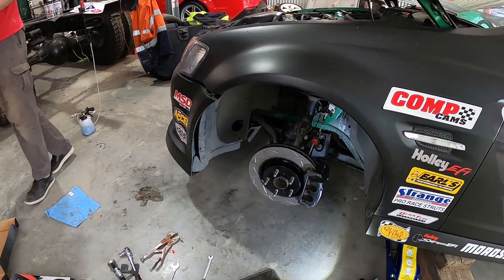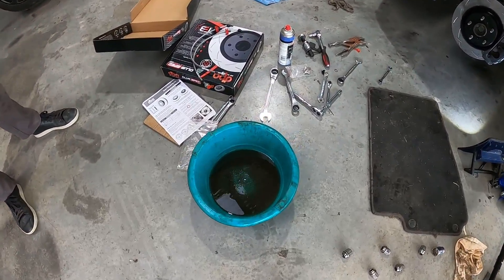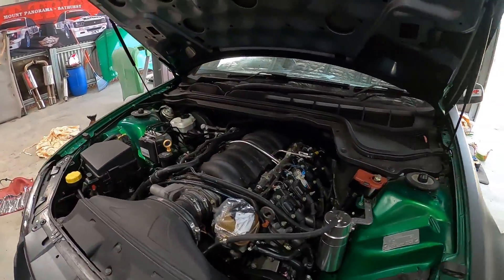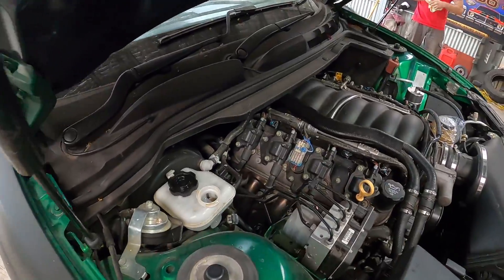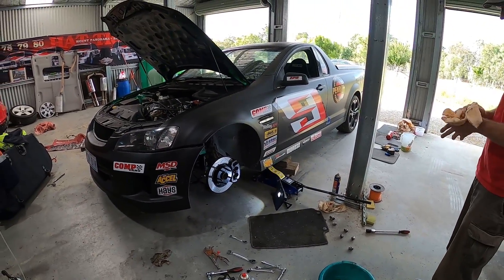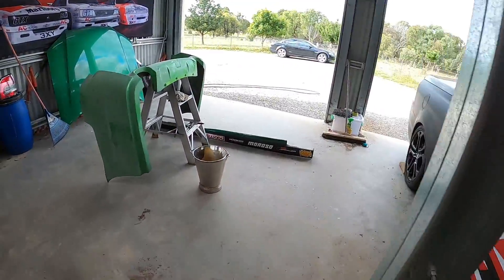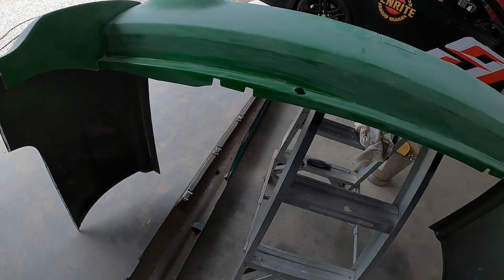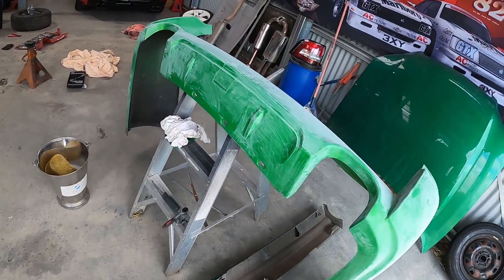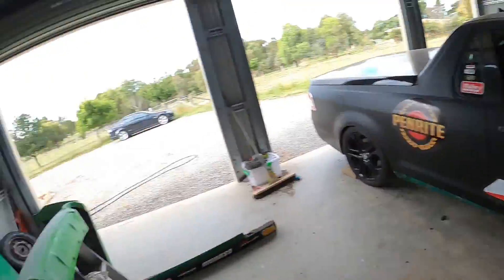We've just bled the brakes with our little two-man trick - nice and greasy and horrible with all that brake fluid. We actually bled the brakes before the last track day too. We're going to top up the reservoir again, put the other wheel on, and then put our tires on and we're done. We've also been scuffing back the rear bar. Don't do it for Dale - do it for Brocky! Hope you enjoyed this video. Hopefully Black Betty will stop a little bit better on our next track day. Still have to do the rears, but we'll do that another time. Thanks for watching.